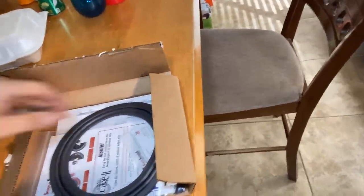Basically, this is the box you get. Let me open it up. That doesn't exist, but this right here is what's going to fix this factory subwoofer. Basically, what happens over time when the subwoofer does go out, it tends to break all the way around its seal. And this is a brand new seal. So what we're going to do is take the old sub out, take all the goop off, clean it up, and then glue this one on. It should be a pretty straightforward process.